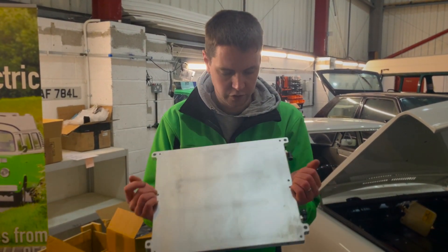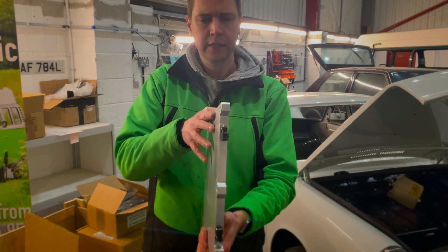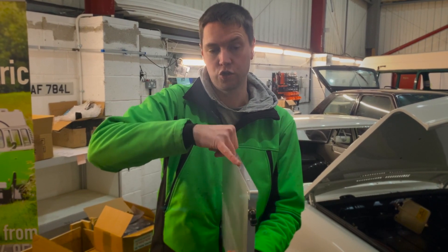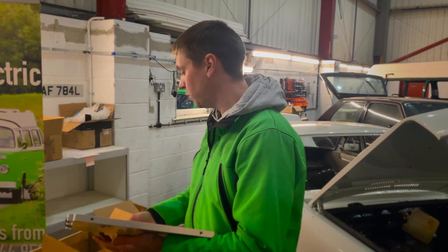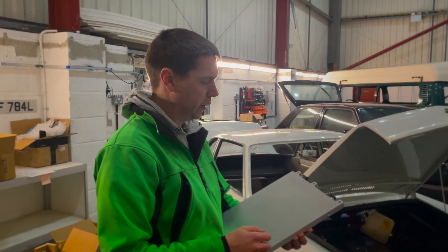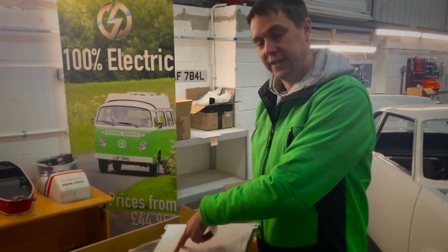These have a cooling channel running through them and back out the other side. We connect those in series to each other. They will stand upright with two modules on one side and two modules on the other, and they will be connected through in the right ways. The cooling plates themselves are structural — you would bolt into the bottom of them through the base of the battery box and likewise onto the top. We've got loads of these for both the BMW and the Golf. The CATL batteries for the Golf are delayed so they aren't in this box, but they'll be with us in a few weeks. We also have a two-and-two plate in here for the BMW battery box design.